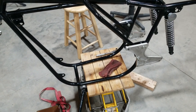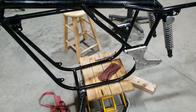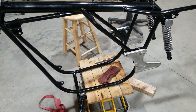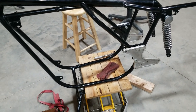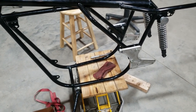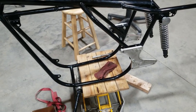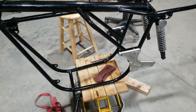There's about three different ways you could replace the wicks and the Welch plugs in these swing arms and pull the swing arm off. We're going to go through some of that stuff, but right now we're going to do this the second way, pressing it while it's all together with the press, and then reinstall it, and hopefully it doesn't leak this next time. Otherwise, we're not sure what we're going to end up doing to keep it from leaking.